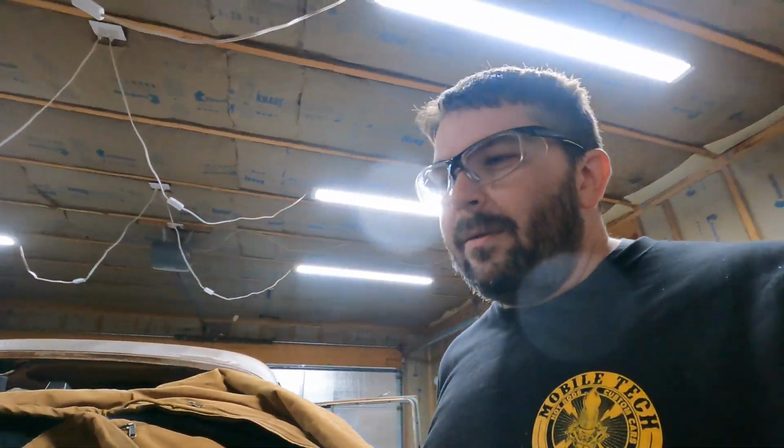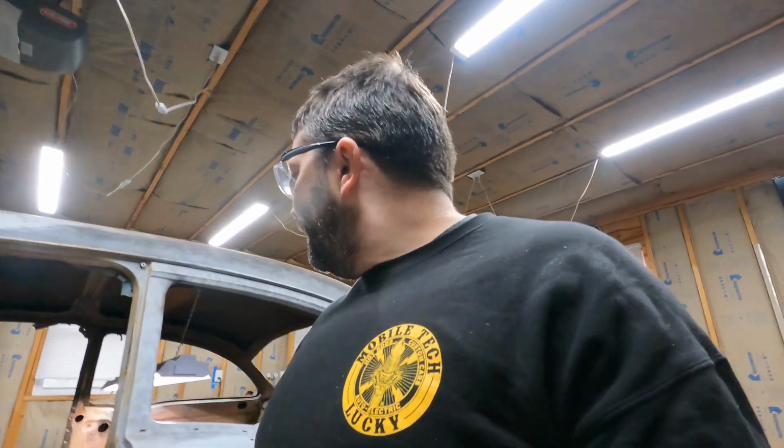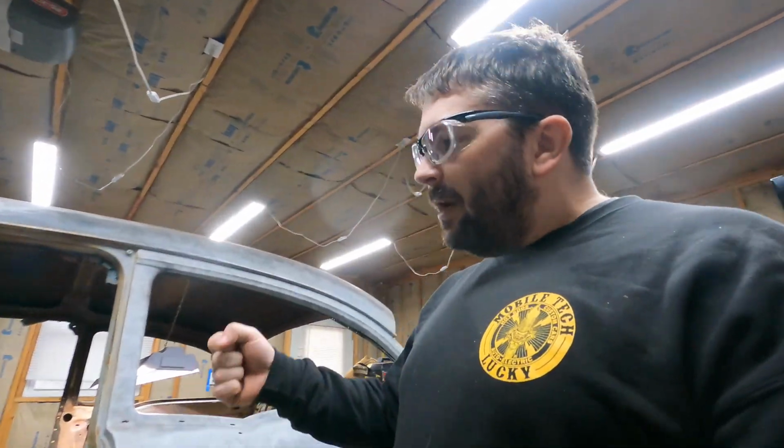That 120 volt motor, it did really well for what it was designed to do. So if I was running like a framing nailer or something, it worked just fine. But anything that has really high CFM consumption, it would drain the tank in about 30 seconds, and then the motor couldn't keep up enough input to run the tool and pump the tank up at the same time. It would just run down and down and down. So use the tool for 30 to 90 seconds and then have to stop and wait 2 or 3 minutes for it to recharge, and just do that cycle over and over again.